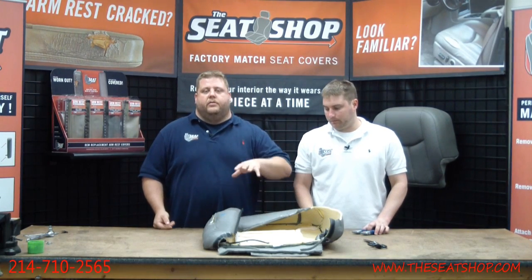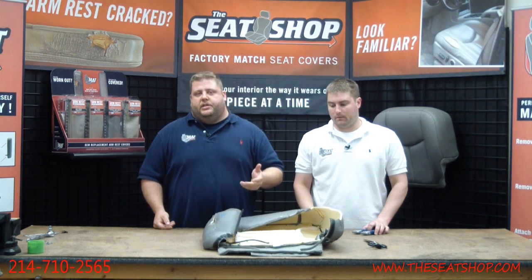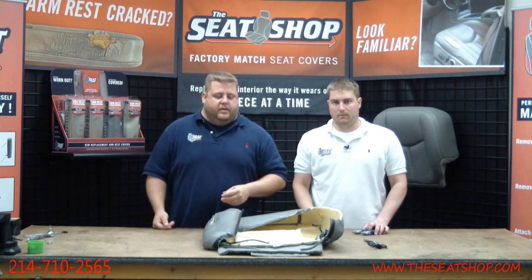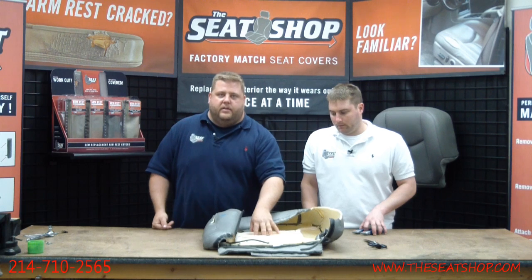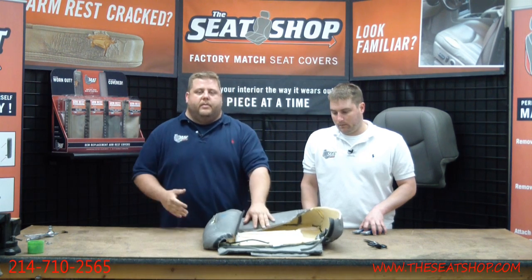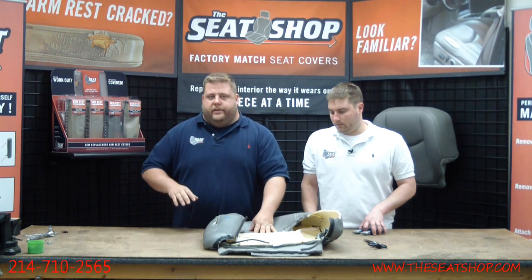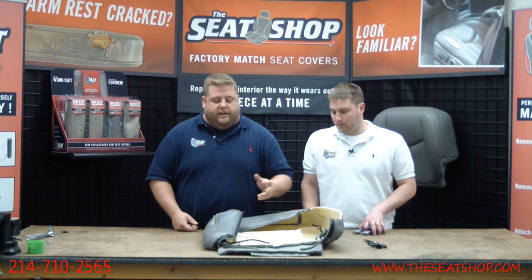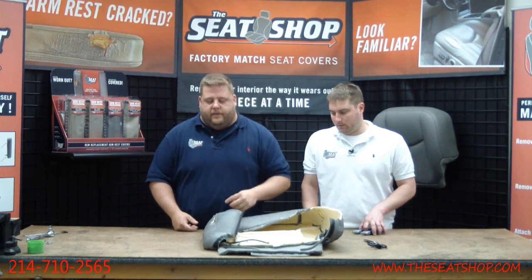Hey, this is Brian with the Seat Shop, and today we're going to show you how to take the heating element out of a 95 through 98 Chevy or GMC pickup, or 95 through 99 Suburban Tahoe Yukon. In this year range, they actually sew the heating element into the cover. They incorporate it into the cover. The newer model stuff, 2000 and newer, the heating element's actually attached to the foam cushion. So the newer stuff, you don't have to do these steps here. But on the older model, 95 through 99, you'll need to remove the old heater to transfer the new one.